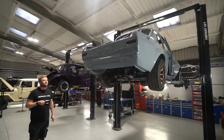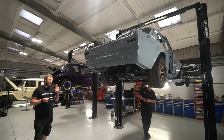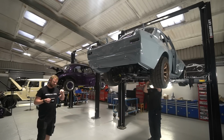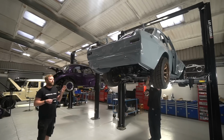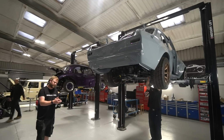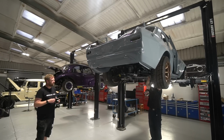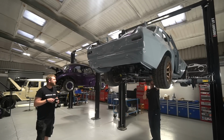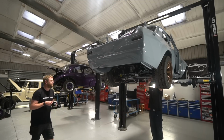So Luke has been working on more of the CAD work for it. I think last week we showed that he was going on some centre console design stuff. We've done some prototype 3D printed pieces of the components that go into that. And then having offered it up in the car, I've wanted to make a couple of changes. I wasn't very happy with the size of the phone holder, because by the time you've actually got a USB plug on the bottom of the phone, if you want to charge it, it wouldn't fit very nicely in there. So we've done a bit of a change to that console just to extend it forward so we could put a longer phone holder into it and simplify the design slightly. So definitely proving the worth of doing the prototype jobs.